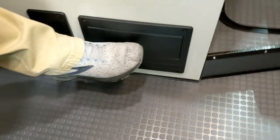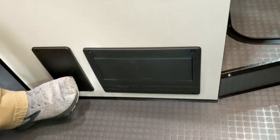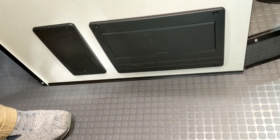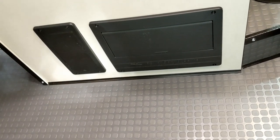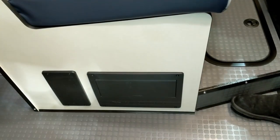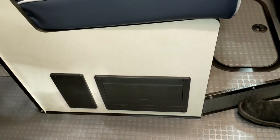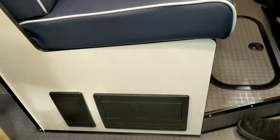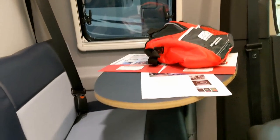This is your 110 breaker panel and 12-volt fuse panel. The breakers are just like the ones in your house. The fuses are standard blade fuses with little red LED lights that come on when they're blown — no guessing which one it is. There are RAM mounts all over the place, and inside there are iPad holders you might want to look into.